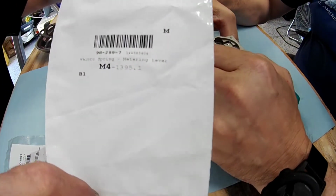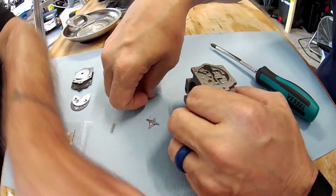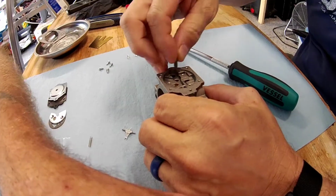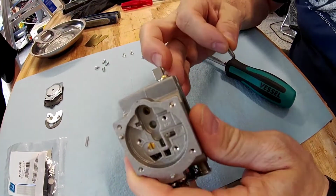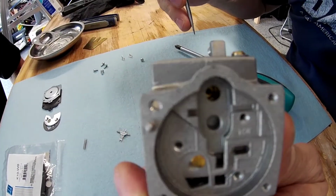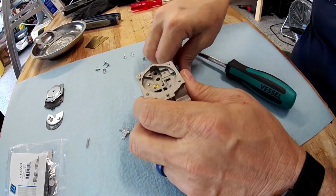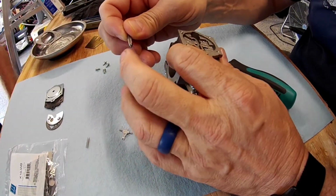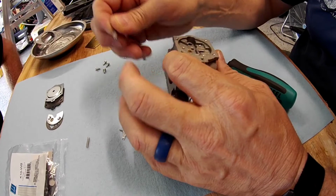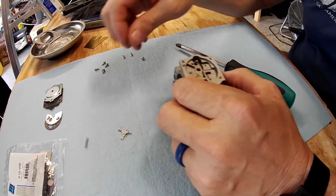The spring to replace it, that's the actual part. That's the spring for the pop-off pressure, if you need it. Botched landing. So, if you can see in here, down in the bottom of here, that little brass ring in there, that is where your plunger seals. And if you feel it, the tip is a hard rubber material, and that's why it'll wear. It's sacrificial for the brass fitting, and the brass fitting gives it a tighter seal.